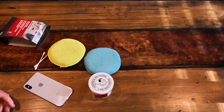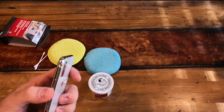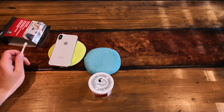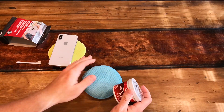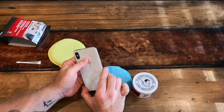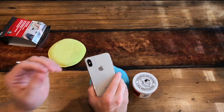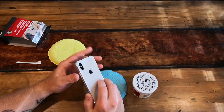One important thing to point out before we get going: this is only going to work for the white iPhone 10. It isn't going to work for space gray, and here's why. The white model has a bare, non-coated stainless steel — just plain silver. The space gray iPhone has a color coat, almost like a laminate, on top of the metal. If you have a scuffed-up space gray, you'll see bare stainless steel underneath. You could try to strip that black coating off, but I'm not going to recommend it — do it at your own risk.